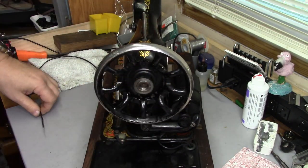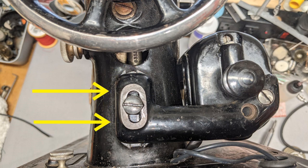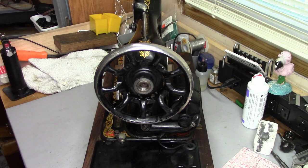Put the balance wheel back on. Loosen the screw here and make sure the motor is midway in its travel on whatever mounting bracket it has — you want a little bit of fudge room, so have it midway in its travel. Now you'll need a piece of string, wire, or something that will fit nicely in that groove.